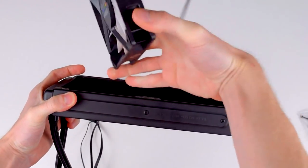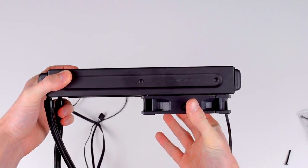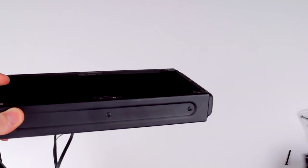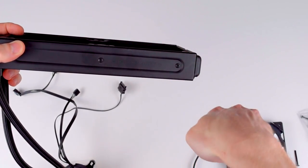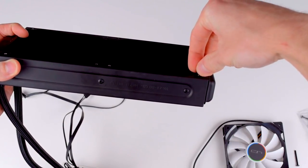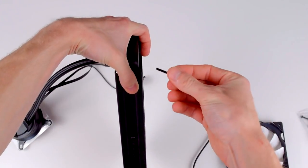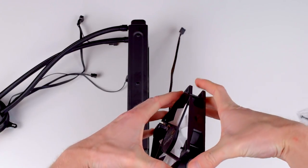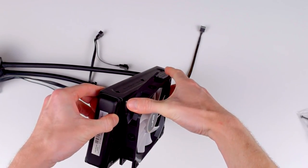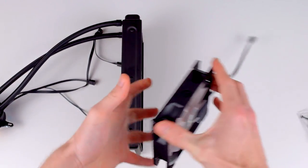Since this is my first all-in-one cooler, I was curious about how exactly you mount the fans to the radiator and then the radiator to the case. It's actually more straightforward than I thought. The radiator has the same mounting screw holes on both sides, so it can be used either on the air intake at the front of the case or exhaust on the top. Cryorig provides two sets of screws — one shorter and one longer — along with a set of washers. The longer set mounts the fans to the radiator, and the shorter set mounts the radiator to the case if using it as exhaust. Otherwise the long screws do double duty of holding both the radiator and fans to the case. The washers are provided to protect the case, but because of the shape of the Masterbox Lite 3.1's front mounting locations I couldn't use them — no biggie.